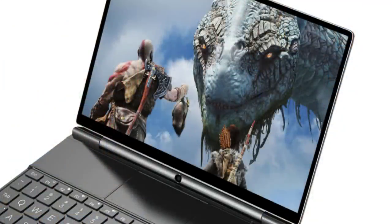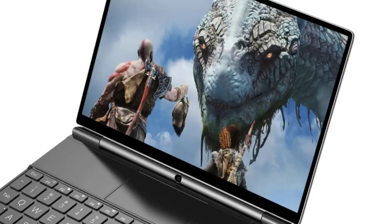On top of that, it is a full touchscreen display — I believe 10-point touch — with active pen support, same as the Pocket 3, with 4096 levels of pen pressure. So full pen support is there. The resolution is rather large at 2560 by 1600, but upscaling technologies like FSR, Magpie, or Lossless Scaling on the Steam Store mean you can run games at lower resolutions and upscale. Very few modern games will run natively at that resolution on either the i7-1280p or the 6800U, but older games will handle it well.